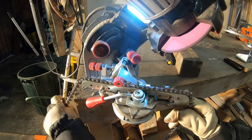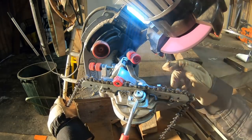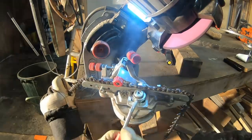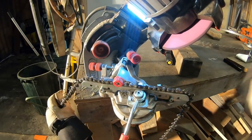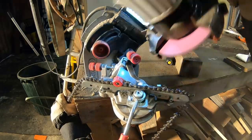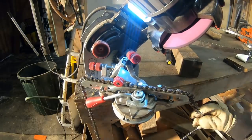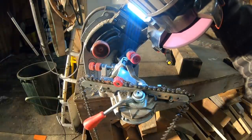See how that barely took any off the top? That's a bit of an issue. Because it barely took anything off there, if I wanted every tooth to be ground down exactly the same, I would reset this to whatever that tooth took off. I'm looking for that black mark — I can check the gullet too. If it's shiny, you know you've sharpened it. That is all done on that side.